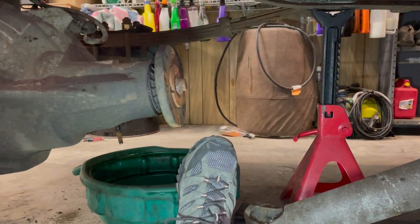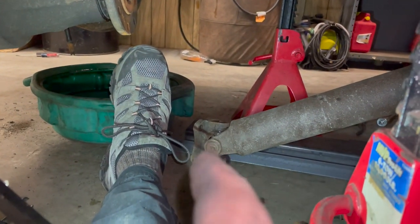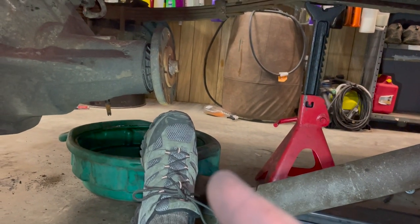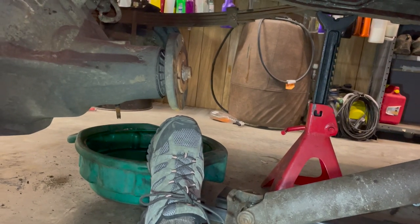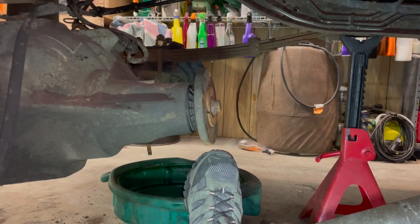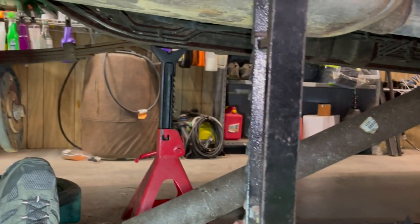You can guess what I found out by the fact that the drive shaft is not sitting in it. This flange is set for a bigger setup on the drive shaft — this puppy is going to need a new drive shaft. What that means for you guys is you need to pull the rear drive shaft off of the F-250, but you also need to make sure it's the same wheelbase F-250. The wheelbase of the Excursion is 137, so you're going to be looking for an F-250 with that wheelbase, or you're just going to get a custom drive shaft like I'm going to do. I'm going to measure up the drive shaft and call Quigley to see if they can knock one out before Moab.